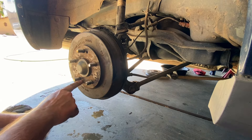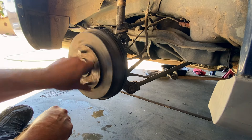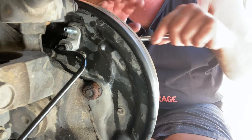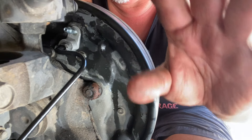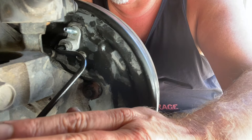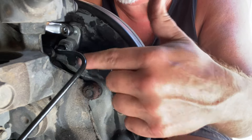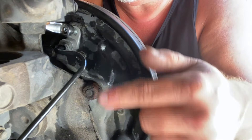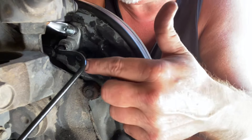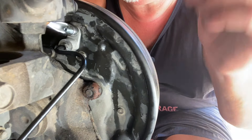New wheel cylinder is installed — we went ahead and put the drum back on and lined it up. Now we can bleed those brakes. If you have your drum screws, put them back in — obviously we don't, it's been who knows how long since those were taken off. Get your wrench ready. You're going to have someone go inside the car and push down on the brake pedal three times slowly — one, two, three. On the third one they hold it and say 'holding.' You put your wrench on the bleeder valve, crack it open, and watch the fluid come out. It should come out in a straight line — not drip drip drip — just shooting straight out. As soon as you see that, that person keeps their foot on the brake until you say get off, then you just tighten it down and move on to the next wheel.